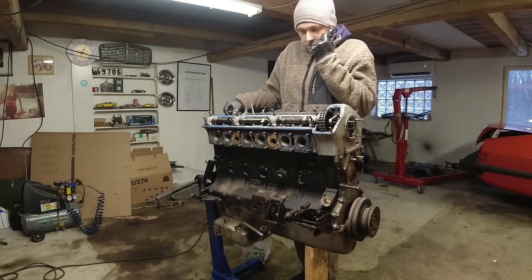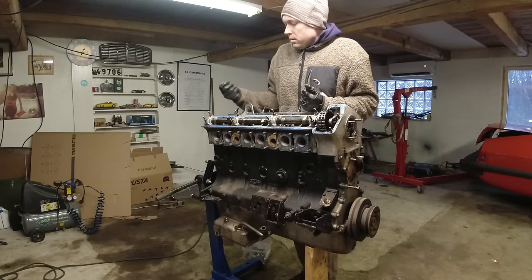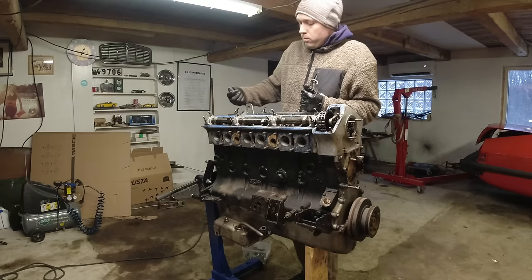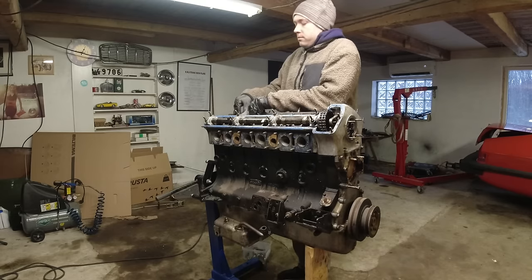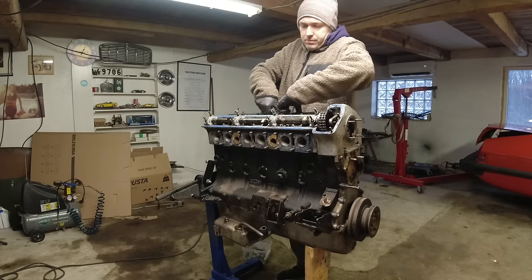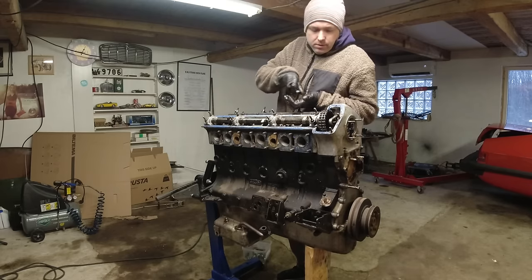If you remember when I put this thing together, we measured everything - measured the thread depth. That's why we have one place where I think we have two long studs, but right here I put double washers just to make sure they did not bottom out. I've looked inside every single one of these and I can still see clean threads at the bottom that haven't been used, so none of them have bottomed out. The camshaft still looks good - no real wear on that.